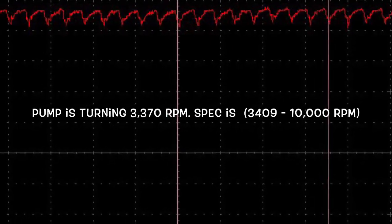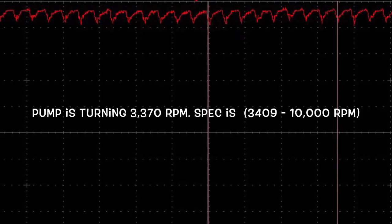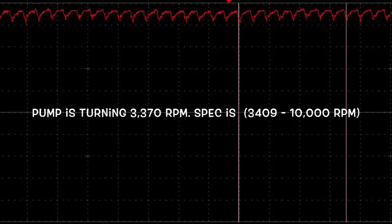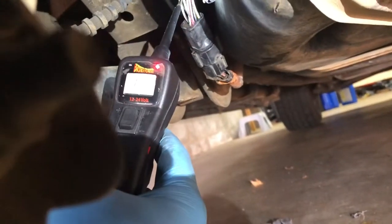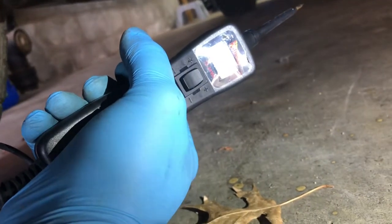The next step is very important. All the evidence right now is looking like we've got a bad fuel pump, but before we can call it a bad fuel pump we've got to check to make sure we've got a good ground and a good power feed at our fuel pump. We've got the connector back-probed at our fuel pump. The hot wire going to the fuel pump is a pink wire with a black tracer. The Power Probe is showing that positive red light and beeping — that's confirmation we have a good power feed going to the fuel pump. The vehicle is running, so I am doing a loaded circuit test.